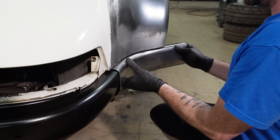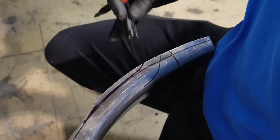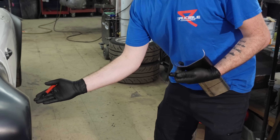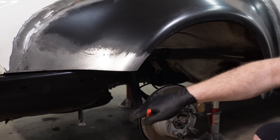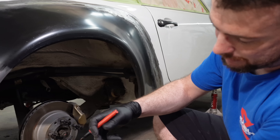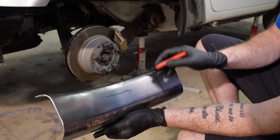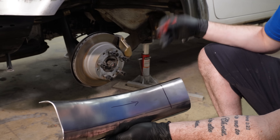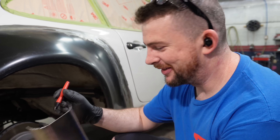Now I've got to get this to wrap over. We're going to have to deep shrink this with the kick shrinker to wrap it around, and the same thing for the bottom. However, the wheel arch flows - when it comes back here it comes back at an angle, it doesn't just go straight down. So where I have it wrap in here, I have to do the same on the bottom, but I also have to space it back so that the wheel arch continues in a nice flowing fashion. That's just another dimension I have to worry about.